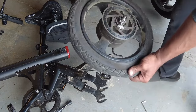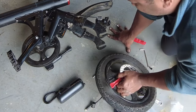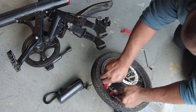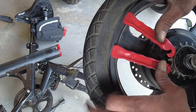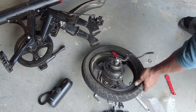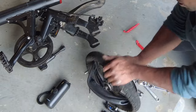Now you've got your back wheel off, and you've got the pleasure and the fun of getting the tire off the rim. This part of the tire change is the same for any bike, except made a bit more painful by these tiny wheels. This is what you're trying to accomplish: getting both tire levers in with a lip over, then you separate those and get that out. Then you repeat for the other side — that's how you break the bead on your wheel. Once you've got one in you start leveraging around the outside. It gets easier the further you go.